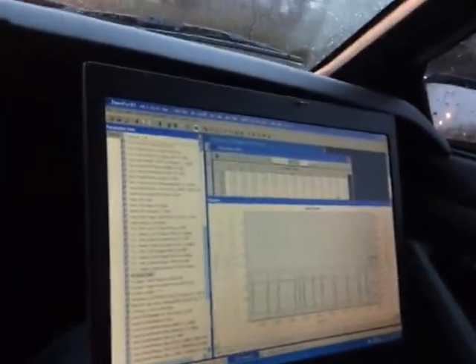How's it looking, George? You're not going to stay at a steady RPM right now? Right now I'm doing very good. I'll be at 2,500 and I'll stay there. What I'm probably going to need you to do is switch the car into a lower gear ratio and keep it at a higher RPM. Okay, so downshifting now — we can just load the car down. We'll keep that at 2,500 RPM right now.